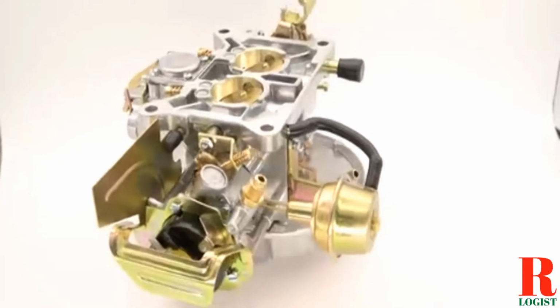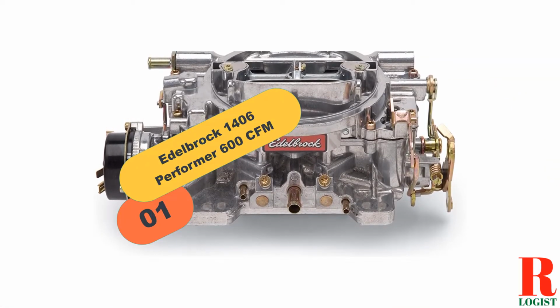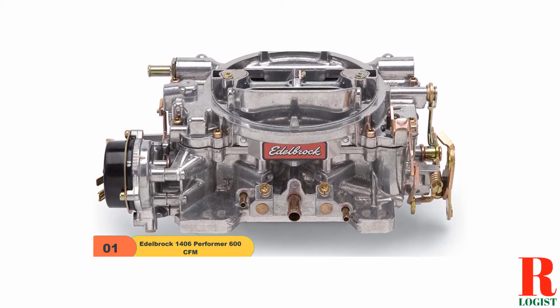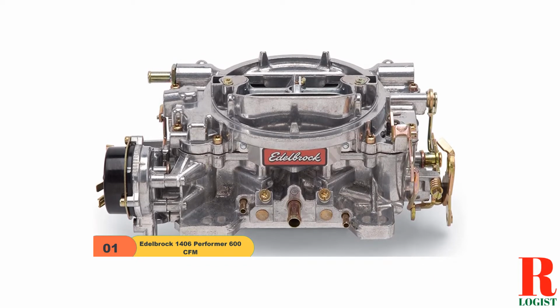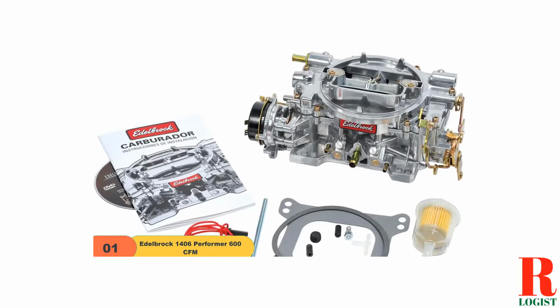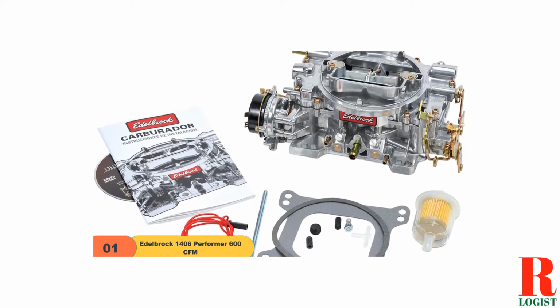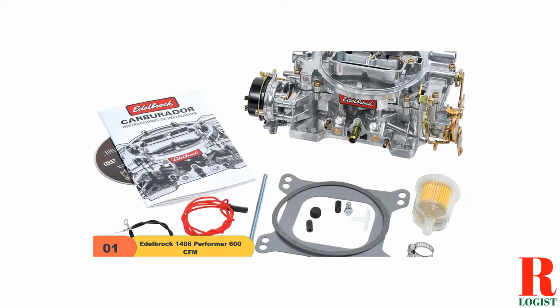Now let's get started. Starting at number 1 on our list, we have the Edelbrock 1406 Performer 600 CFM. The Edelbrock Performer square-bore air valve secondary electric choke new carburetor features a 2-piece, all-aluminum construction for cooler operating temperatures and less warping. It is designed and calibrated for good street performance and fuel economy in 402 cubic inch and larger engines with the Edelbrock Performer manifolds.